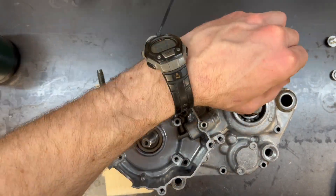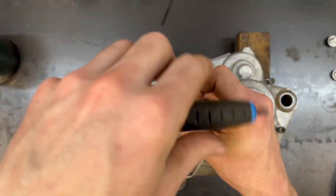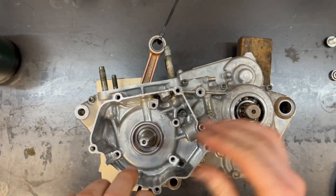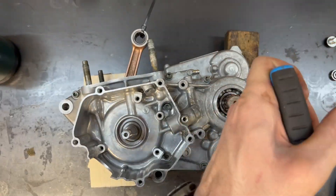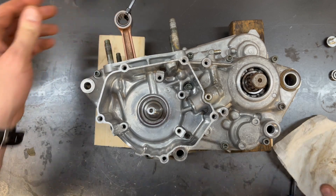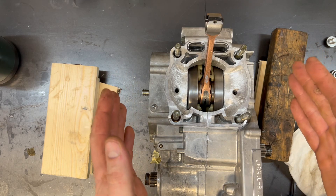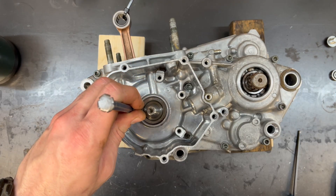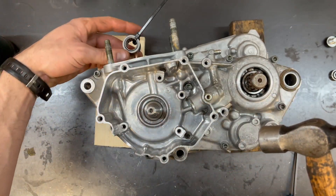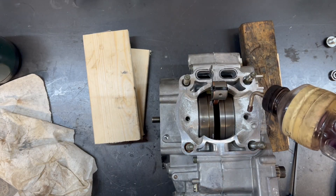Now back to this left side, right side thing. As I put these bolts in, the bearing on the left side that I heated up is already cooling down and clamping itself onto the crank. That means as I tighten these bolts up, I'm introducing a small amount of side load to the crank bearings. When I'm all finished up and go to rotate the crank, it feels like there's quite a bit of resistance — it is not smooth. So our current situation is the crank is pushing outward on the main bearings. All I need to do is relieve that pressure, and I'm going to do it in a very non-traditional way. You can see that tension is completely gone. Now as I put a little two-stroke oil down on the bottom end, we'll talk about this a little bit more.